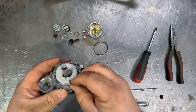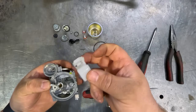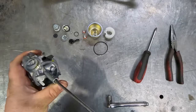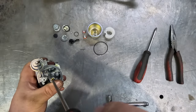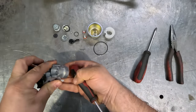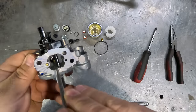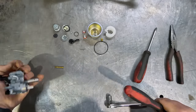Now your little float — push the pin through, that little pin will pull through, and your float and your needle will pull out as one. The next part is to remove the jets inside the carby. Get a flat blade screwdriver with a smaller head so it fits down inside the chamber and undo the brass jet — be very careful because it is made out of brass and is very soft, so it can be damaged quite easily. There is also a smaller jet inside the tube which you can just push out — just put your screwdriver head on top of it, push it down with a gentle tap and it will come out.